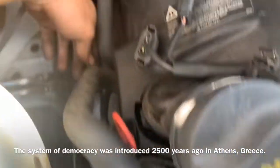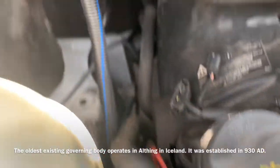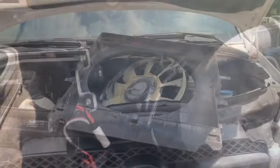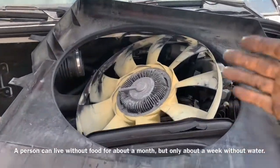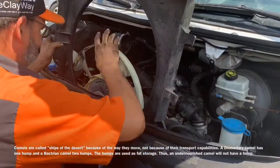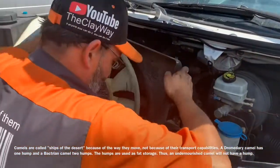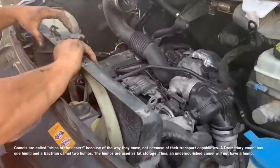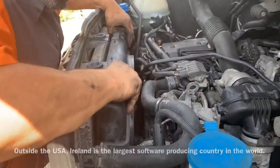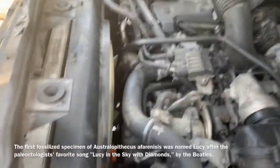Since Dakota's down there I'm going to have him pass me up the wires behind the alternator and pull them through so I can attach my regulator to my firewall. Now we're going to reinstall our fan blade and fan shroud at the same time. I'm going to make sure it's going into its proper location at the bottom of the radiator — I generally work from the passenger side to the driver's side. I did have to bang it with my hand to get it past the radiator hose a little bit.